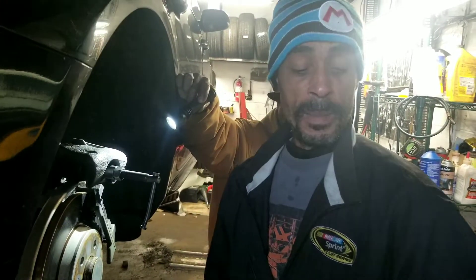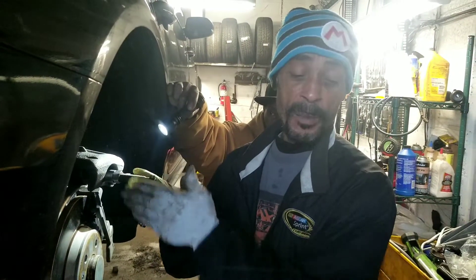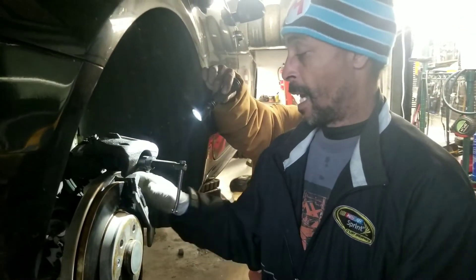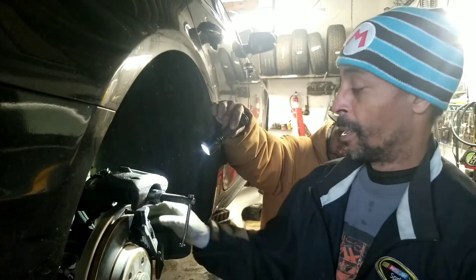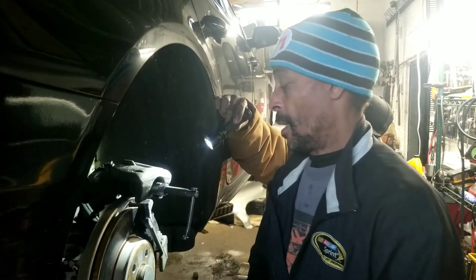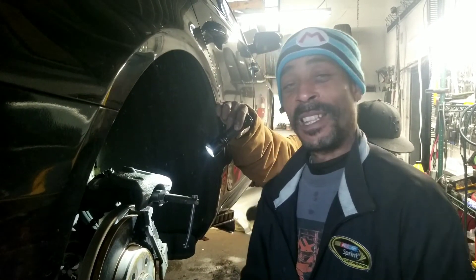Just wanted to give you that quick tidbit — the rest of it's pretty simple, it's a basic brake job: put new pads on there, and of course if your rotors are damaged go ahead and turn them while you've got this thing apart. Once you have this pressed all the way in, you'll want to close that valve back off, load your caliper onto the bracket, hop inside the car, press on the brake pedal until the pedal feels firm — that way you know your brakes are engaged — and you should be good to go. If you have any comments or questions, please post, chat, subscribe. Thanks for watching YouTube, have a great day.